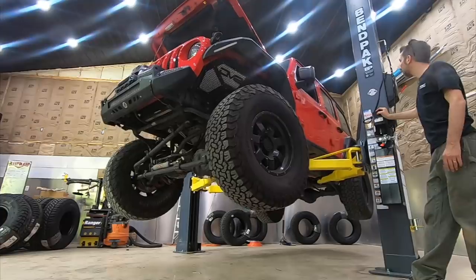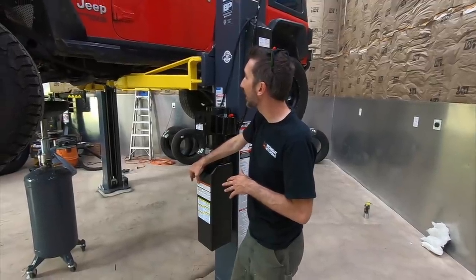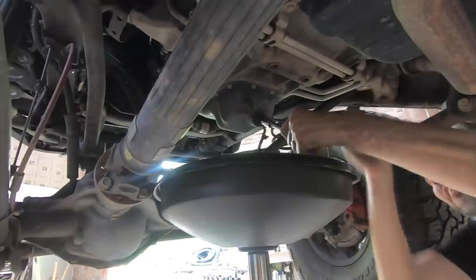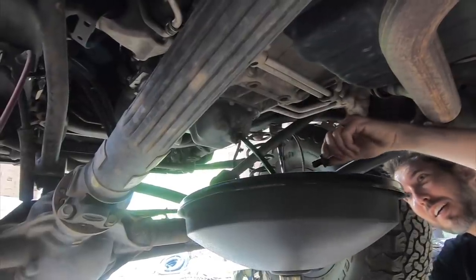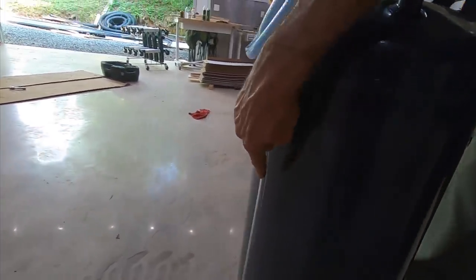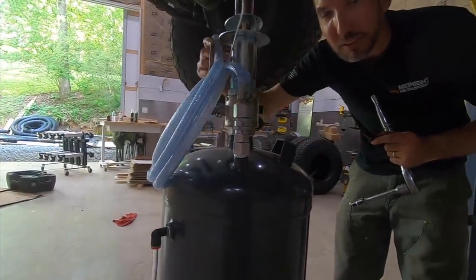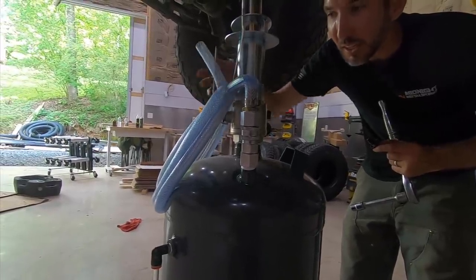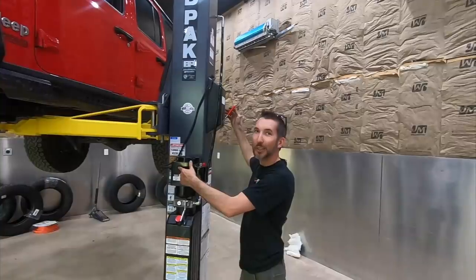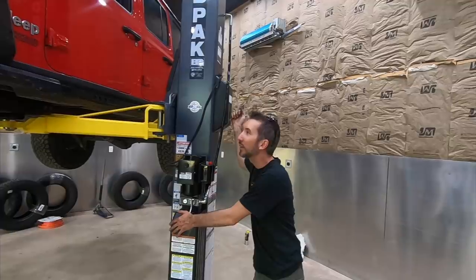The way this works is you put it up with the hydraulics, but then you want to set it down on the safety stops. So that's now on the safety stops - the hydraulics aren't holding it, it's metal to metal. It'll tell you whenever it's getting full - it has a level gauge right there. When you're done, all you do is hook your compressed air into it right here and feed this hose into some sort of a catch bucket and it pumps it right out. When you're all done, you raise it up off the lock, then pull that and push this and it drops down - you just have to wait for a while.